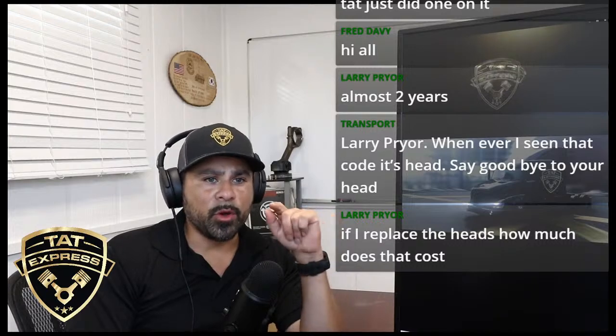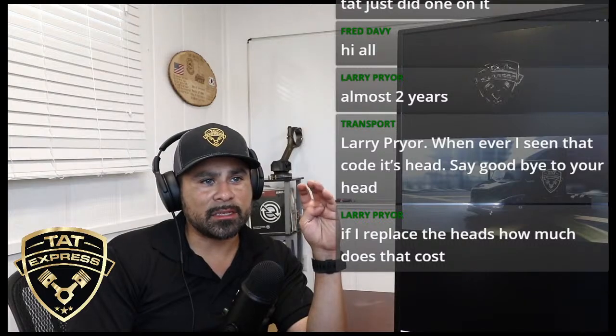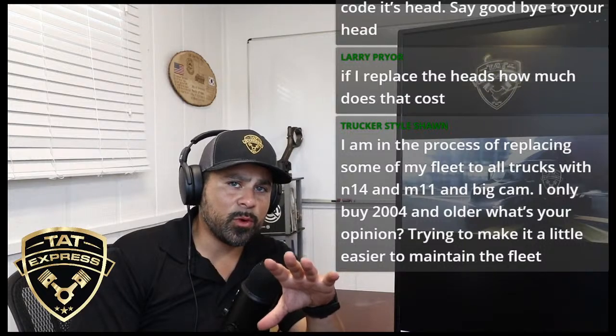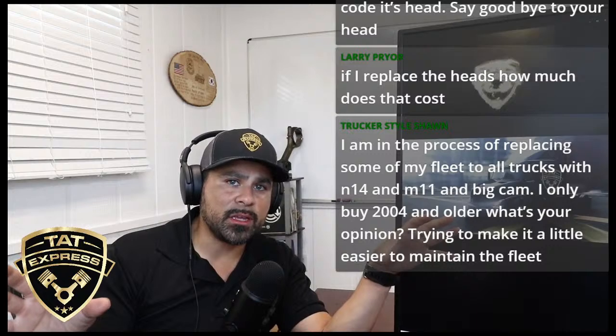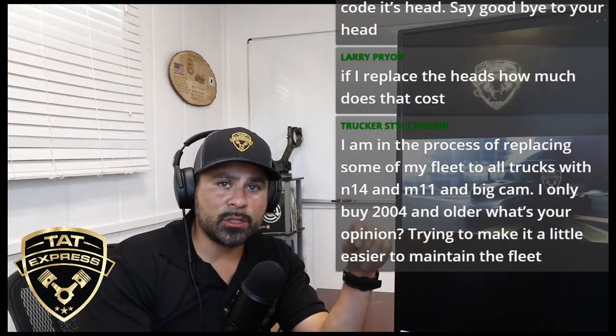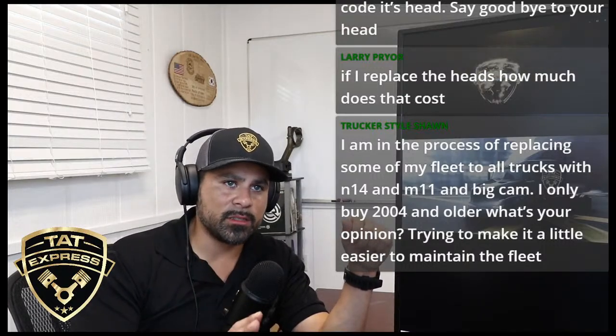I know we did the fuel pump because you found metal in the fuel pump. If I replace the head, how much is it going to cost? It's not going to be cheap, man. It's going to be an expensive repair. So what I would suggest we do, Larry, before we jump on the head, is this. The head is suspected, but when we're testing through this, you don't want to jump directly to a conclusion without doing tests. Now, an injector could also cause this particular code.